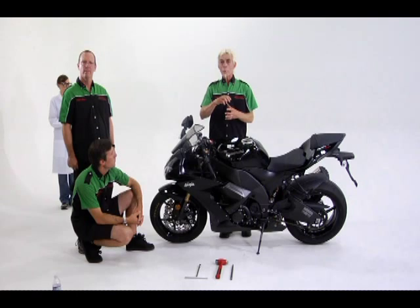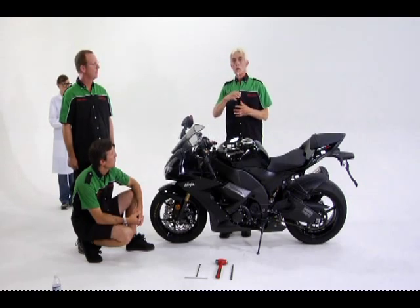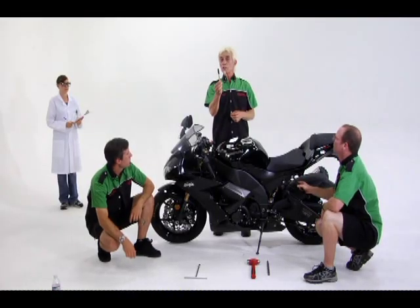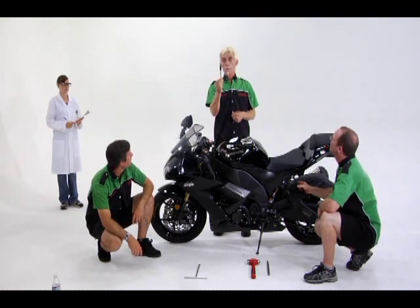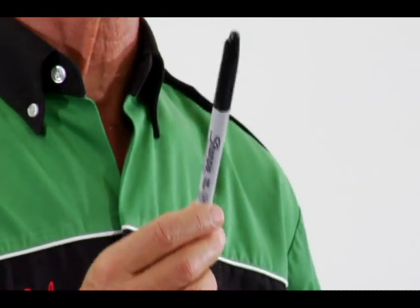The top ring locks off the bottom ring, and first we have to loosen it with the hammer and the drift, and then spin it up away from the lower ring, which is holding pressure on the spring. This can be time consuming, as you will only be able to move the ring about 1/8 of a turn at a time. One other tool it's a good idea to have in your hand is a felt tip marker. It's a good idea to mark both the ring and the shock so you can see your progress.